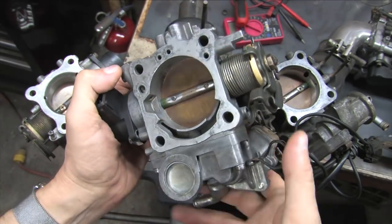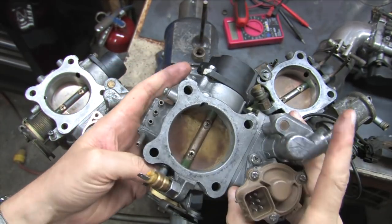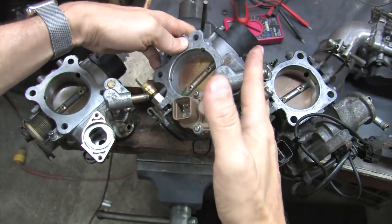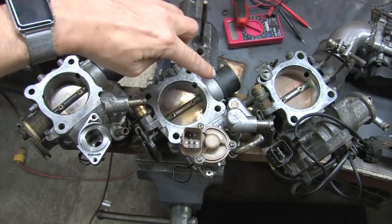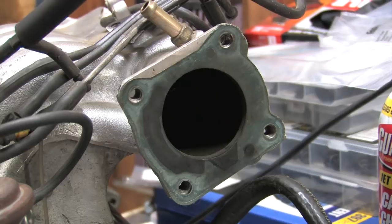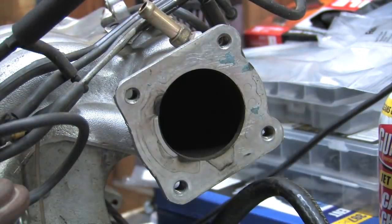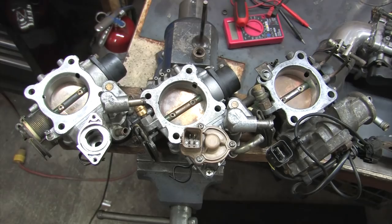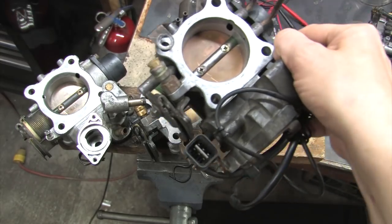They're not far off, so if you've got a second generation car and you want a factory upgrade that you can service, easily install, and still allow your turbo car to behave normally on the street, the 91-94 first generation turbo throttle body is your best bet. Of course, the hole in your intake manifold isn't going to be big enough for it, but you can fix that. Swapping out throttle bodies on a 90 model engine is where all the problems arise.